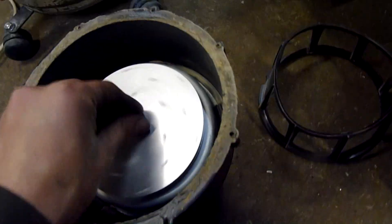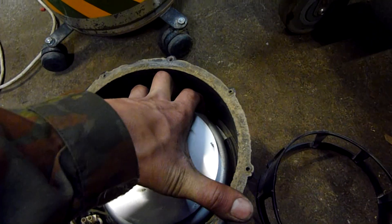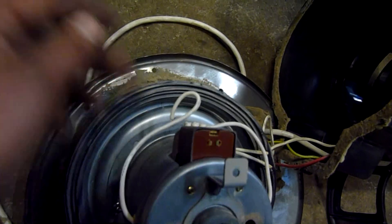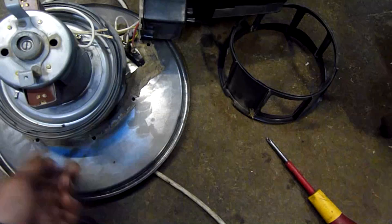It's a fairly big pump in this thing. No outer housing over it though — it's just got that plastic deflector and the end housing. It's really simple. I'm just going to go through and check all the wiring and try and get into the bottom of it, if I can get the motor out. Fairly serious looking motor. Just got to reattach that wire to the housing. I think it's a field winding — one going to the brush, one going to the field, and then brush and field going to the main switch. So yeah, field winding's disconnected. Pretty straightforward. Clean it up, glue it back together again because all this crap's gone hard and crumbly. Stuff it back together again and test it.